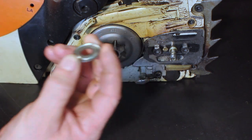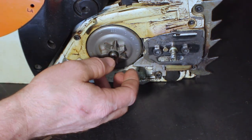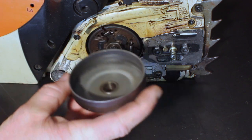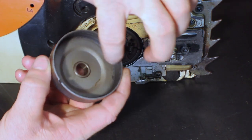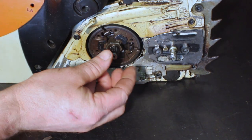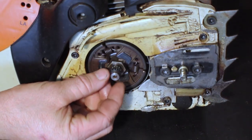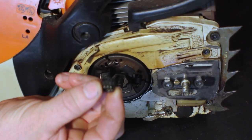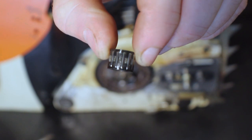There's your holder, and as long as your chain brake is off this will come off. If it doesn't come off or gets stuck, you probably have a lot of buildup in there so you're just going to have to work on it and get it out. As you can see there we have our cage bearing — our needle bearing for the clutch.